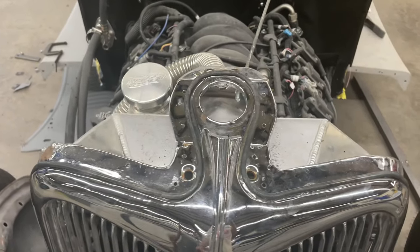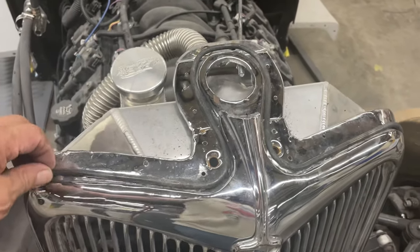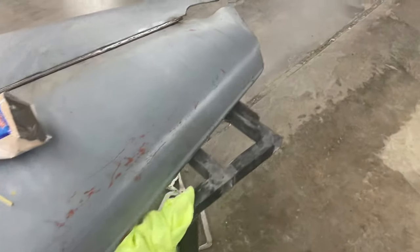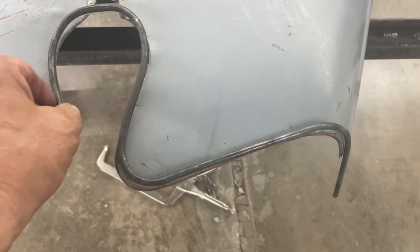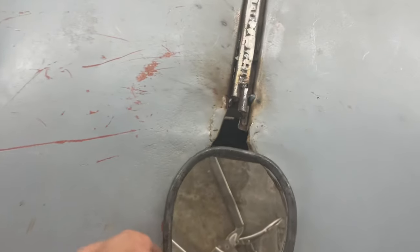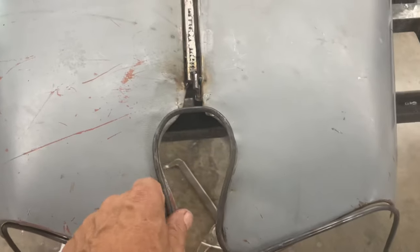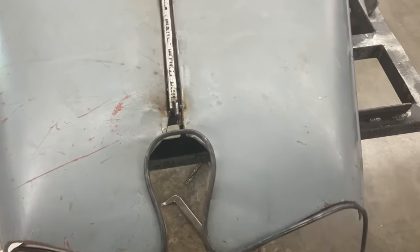It'd be nice if I could just focus — I'm fabricating and building this — but that can't happen. I can't spend an eight-hour day on it. So what I'm going to do is take this, set the hood up along here, mark where this is, cut the hood, and weld this rod into the hood. You can kind of see I've got a shape here that I want for the hood. This has been welded up; it had rust and missing pieces — that's what I had to work with on the hood.